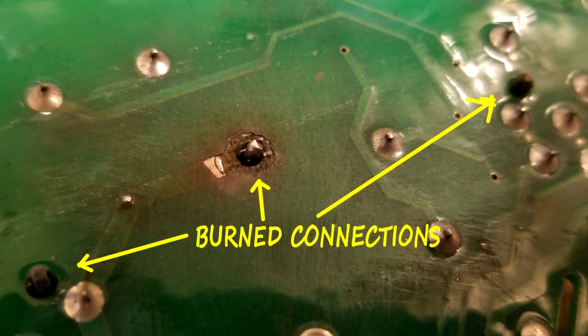But there's a reason why the relay overheated, and that means that the relay is starting to go bad. So even if you repair it with a solder and have it working for a while, it'll eventually overheat again, and then it'll melt those contacts again. So I would recommend that you're just better off getting a new control board or have it repaired. There's some online repair shops that will repair electronic control boards for around $70, including shipping.